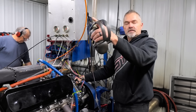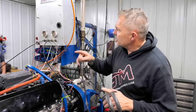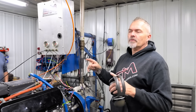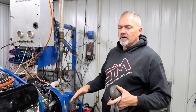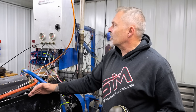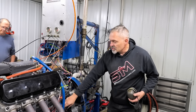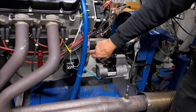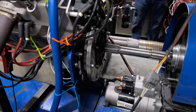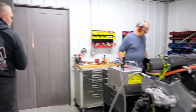The flywheel faces forward going into a step-down transmission — 2.3 to 1 step-down — because the prop is spinning really slow relative to engine speed, keeping it under 4700 RPM at the prop tip. They put their ignition system and magnets in the flywheel: one set of magnets with two sensors. We'll start this up on one ignition and then turn on the second ignition while it's running.